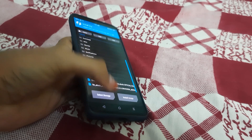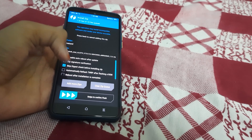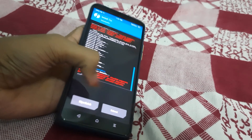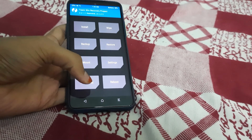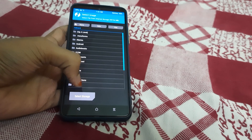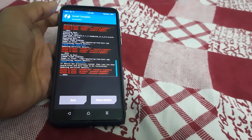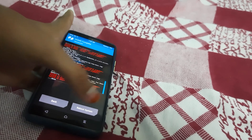Go back and flash the firmware zip — do not select anything else, just swipe to install. The installation took about five seconds. Fail-to-mount errors can be ignored again. Then go to Home, Advanced, Install Recovery Ramdisk, select your TWRP file, and swipe to install. These fail-to-mount errors can also be ignored.